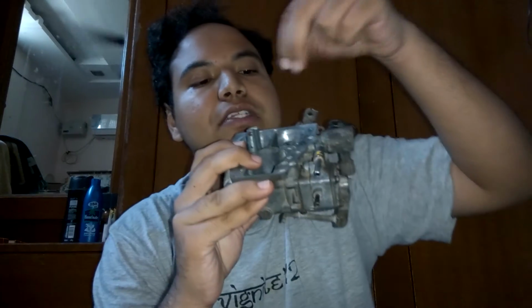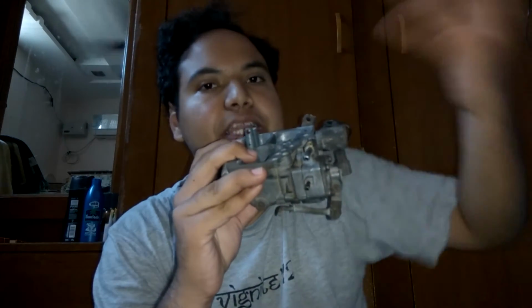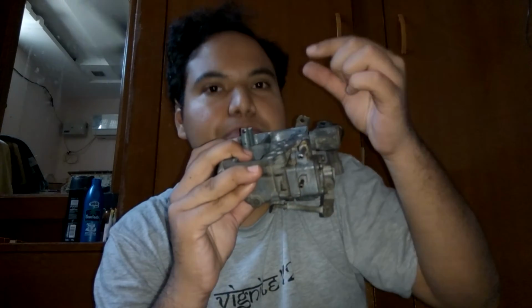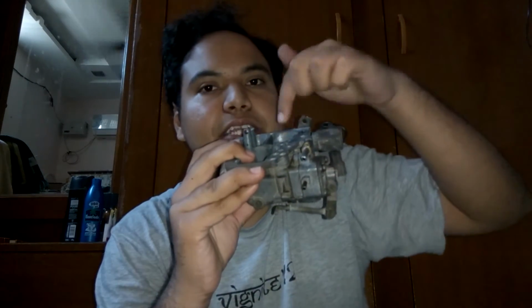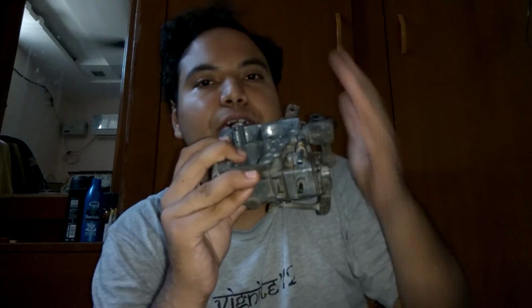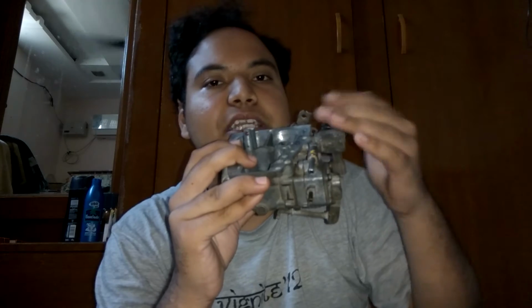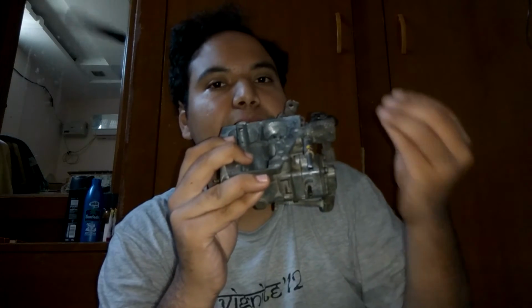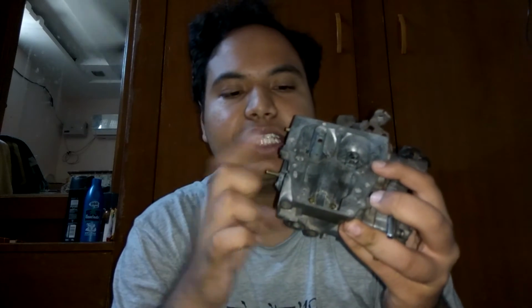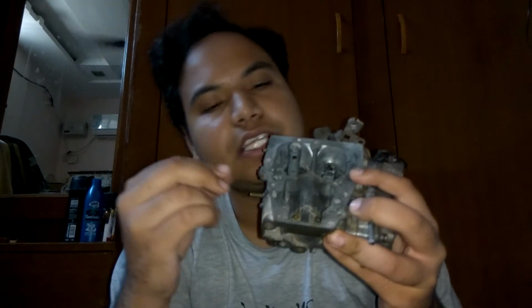The more the petrol starts falling in without any mixture of air, it means that you have lumps, big droplets of petrol getting into the engine, and so it won't mix with the air properly and you won't get enough combustion. That will also decrease your mileage, and your performance gains won't be that much because that petrol has not burnt yet. So it's a good idea to leave it at 1.5 rotations anti-clockwise from the fullest tight position.